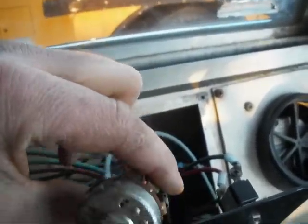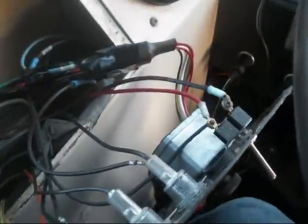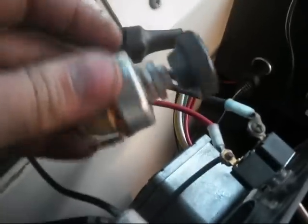And there's your switch that we're going to go ahead and swap. I've got the switch all put in now — that's the new switch, and this is the old one here. Big difference in the two. I've got it all wired up, and it was just simple: move wires to the right location, take them off the old switch and plug into the spades on here. The only thing I had to do was add an extra wire for the ground, because the delay uses the hot that comes in to control the wipers, and it needs a ground for that circuit. So that's put in here.